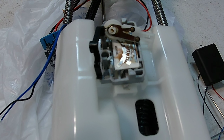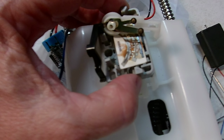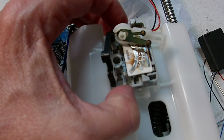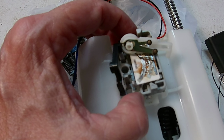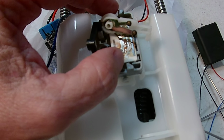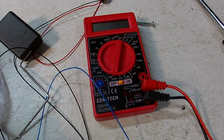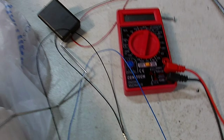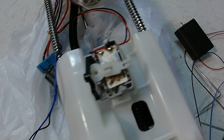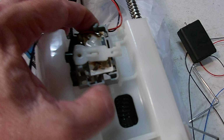And I just think it's kind of ridiculous what they charge. I mean, I've seen replacements of this unit be expensive, and this is a 2 to, I believe, 80 or 85 ohm unit. Mine was reading all over the place, like 500 ohms. I have it on my ohm meter here, and I'll show you the new one, which is a cheapo one. So yeah, you release this lower tab and you push this down.